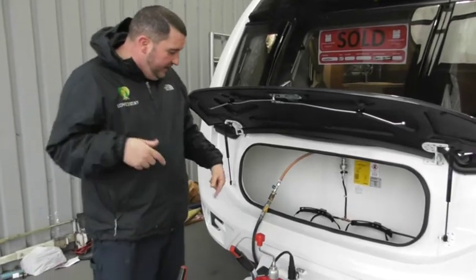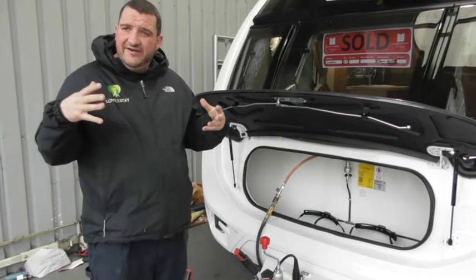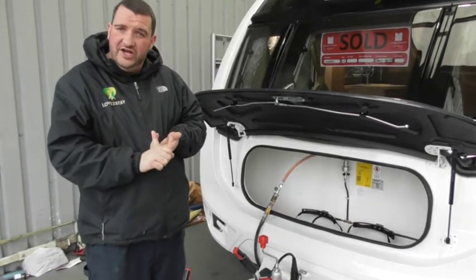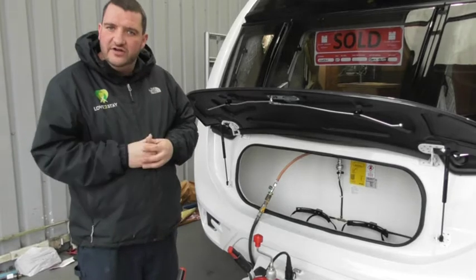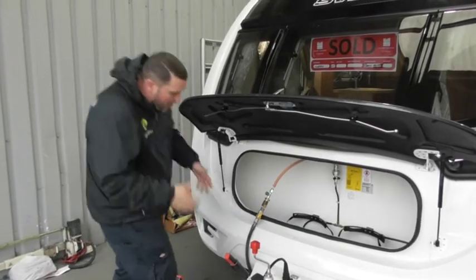But what it does, when you plug it into the car, it goes through a light sequence there. It all starts off as a red light, and then you hear it testing its motors, and then it goes to either a green flashing or green solid light. Green solid light means you're good to go. Green flashing means the system's not quite ready. Pull it down the road a few metres, stop, get out and have a look and see it's got to green. Okay. It's easy as that. But I know you're not towing. I'm not towing. So I won't go too much into it.